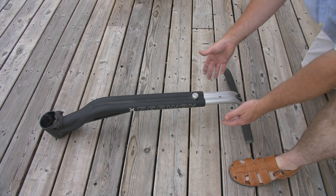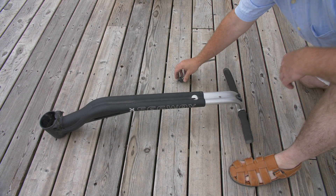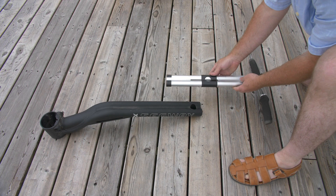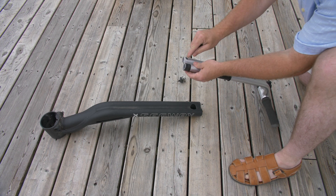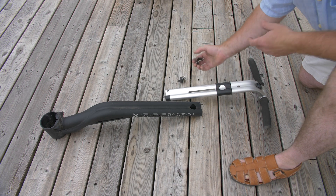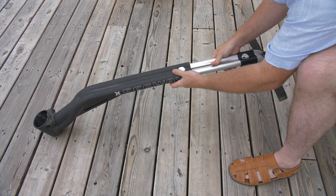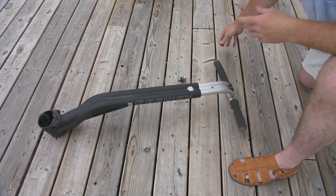After the lean steer is off the Segway, we want to take apart the top and bottom half. We basically completely undo the tension adjuster used for setting the handlebar height and take that out entirely. On the inside, there's a plastic collar which sits near the top, and also plastic pieces that are press-fit on with small dimples that slot into holes. After we cut this, we'll need to re-drill those holes further up so we can remount these pieces — otherwise the top bar would have slop. That'll be quite important to have back in the build after cutting the two pieces.